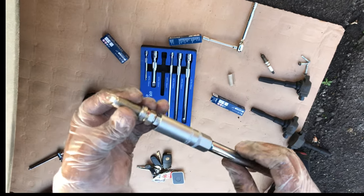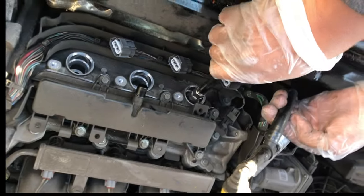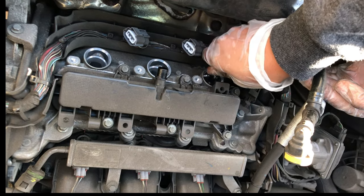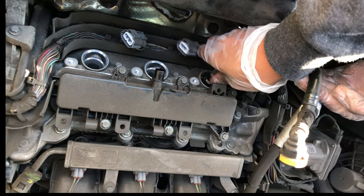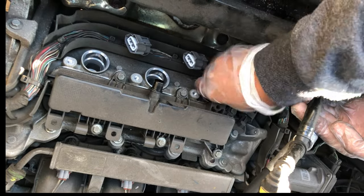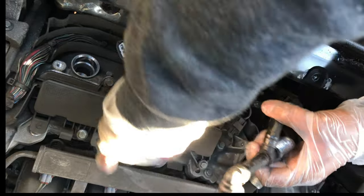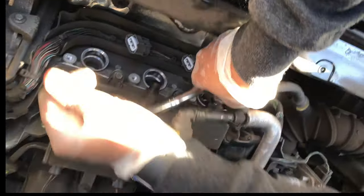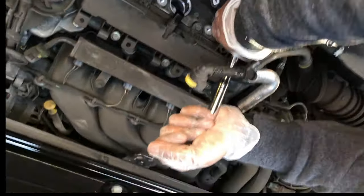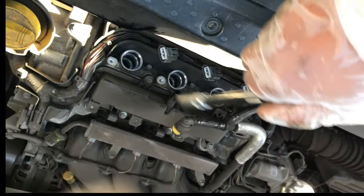So we're going for our Bosch spark plug. Just remember guys, this is a 14mm - it's not a usual size - so make sure you have this socket. We're going to hand tighten it first so we don't cross-thread. We always hand tighten. Once you start getting a bite, tighten it off with a ratchet - don't over-tighten, just until it stops. That's enough. It's going to be the same for the other two but I'm not going to bother filming it.